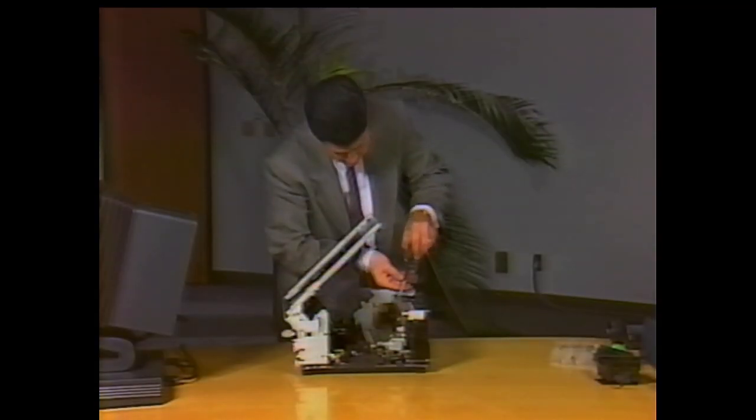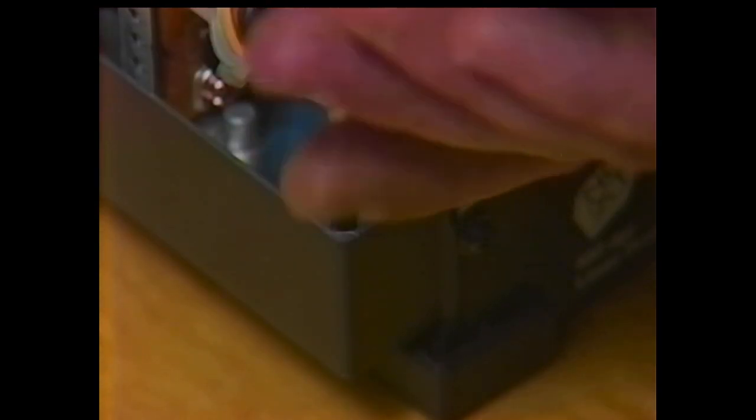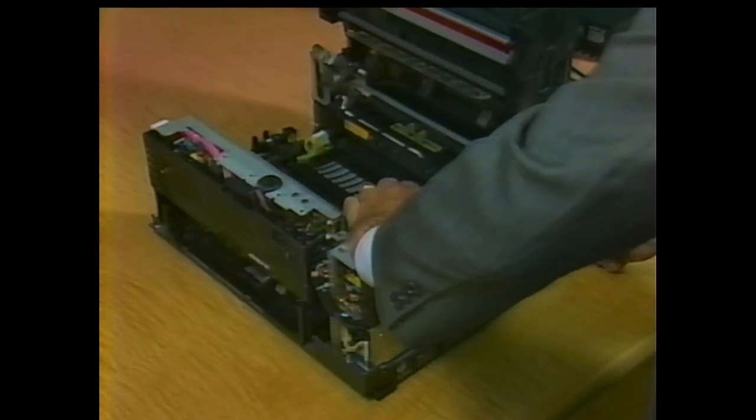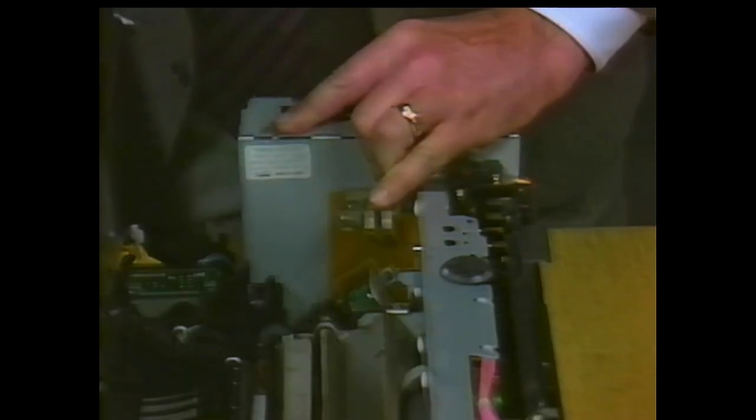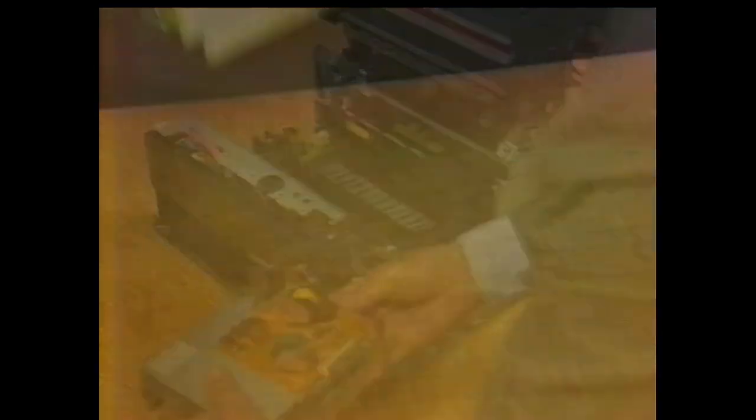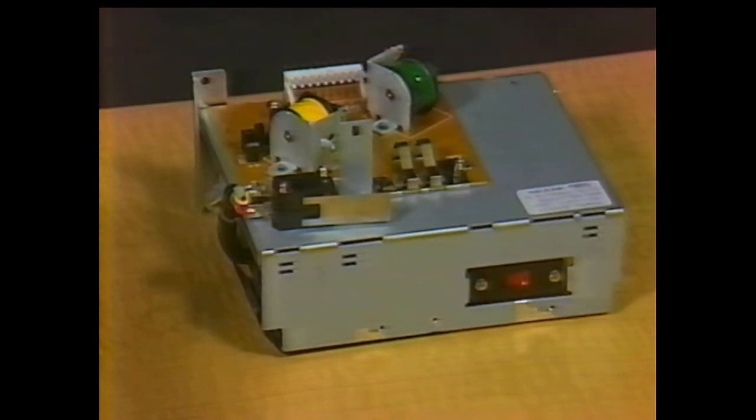To replace the low voltage power supply, remove the screw from its bracket, then the three screws that secure the power supply to the printer base. These screws have both locking and common washers attached. Lift the power supply straight up to remove it, rocking it slightly to loosen it from the connectors below. Be careful when removing the power supply — don't break the paper tray sensing cam.